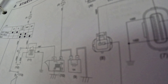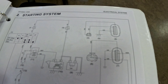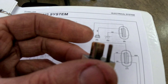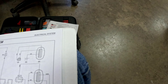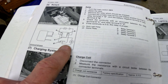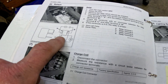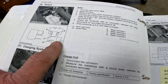Here is a schematic of the relay. What I'm going to do is try this on both of them — basically short these two contacts, which would be the ones that look like copper, and see if I can get the starter to go. That's another way of confirming it. I've got to be out there at the vehicle that has a 12-volt battery. You can see the contacts — it talks about measuring resistance here. When you apply a voltage as it's showing, the relay should click, and then there should be a short here if it's working fine. If I short these two, it will apply power to whatever circuit is in the wiring harness, so I should be able to make it start.